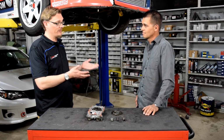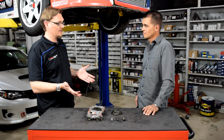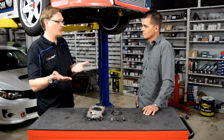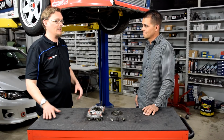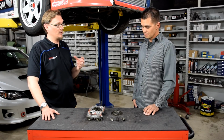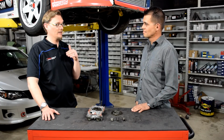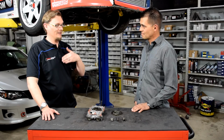So fortunately, you've been running those gauges before. You knew what it was before with the old engine. Now you've got the new engine that's slightly different tolerances, and so you could see that, hey, there's a difference here. The pressure at road hot is not what it used to be, quite. That's correct. So that was the indication that, hey, something has changed enough to the point where if you want your target pressure to be at a certain threshold, you have to look at a change. Right. So that's when the shimming comes in.